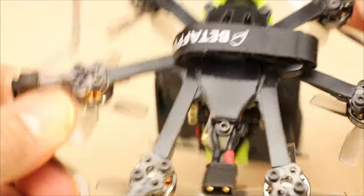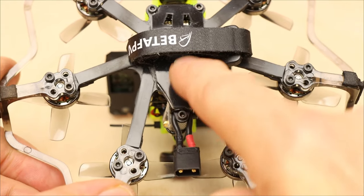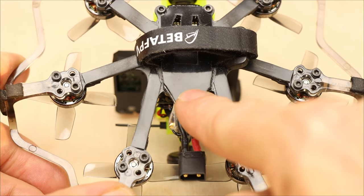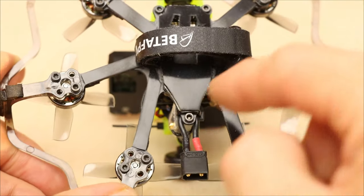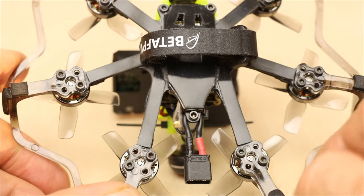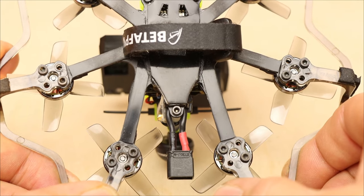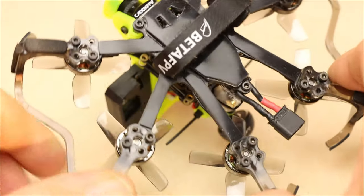and then on the bottom I've added another strap, and then as good as this strap pad was, I've added one on top. It's only like a millimeter thick rubber, but I had to do that because when I cranked up the strap, the battery was getting pulled into the bolts there and indenting, and obviously that's no good. It will damage your battery, and obviously in a crash it could cause even more problems, god forbid catch on fire with a big impact.